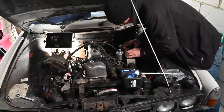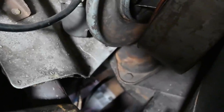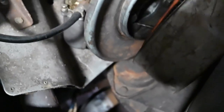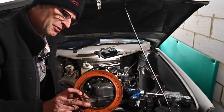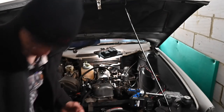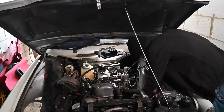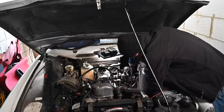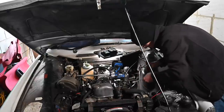That's well tight. Got a better view now of the engine mount. These are the two small bolts — the same as the ones I just managed to undo on the other side, so hopefully I can whip that out in no time. I might even need to take the carburettor off, which is annoying. The air filter is off now, giving me a lot more access. I wish I'd got a new filter element for this because that's pretty grim — well overdue a change. Half inch on the bottom. Done. Easy. I might even go as far as to say peasy — complete with the washer.